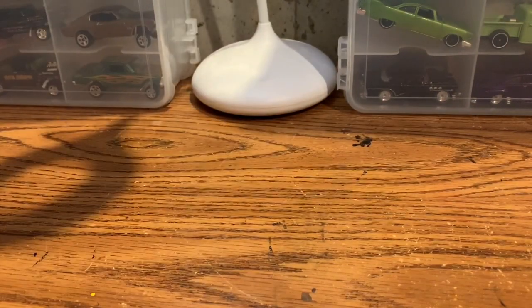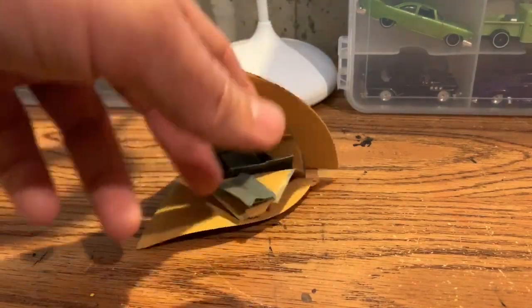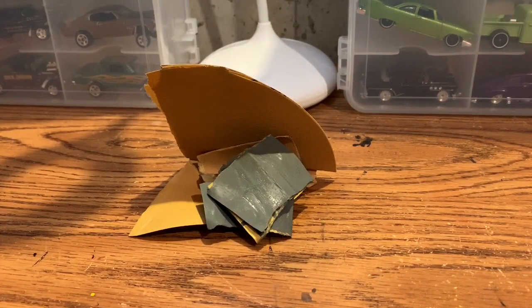Then, next step, you've got your car torn apart. Well, you've got to strip it. There's a couple different ways of doing this. The cheapest, most low-buck way is to get yourself some sandpaper, scuff up the factory paint job, and then just shoot right over the top of that. Now, is that going to look the best? Is that going to be a show-stopping paint job? No. But if your standards aren't super high, you're just getting started, you don't have a lot of money, you just want to practice, that's how I started. Like 15 years ago, when I started doing cars, I would just scuff the car up and paint over the factory paint job. Easiest, cheapest way to do it.